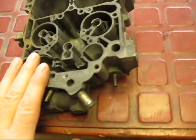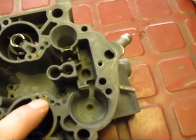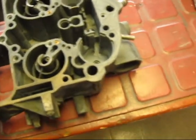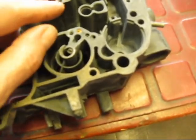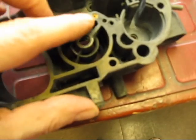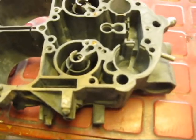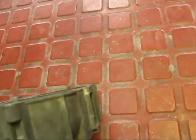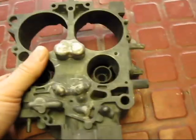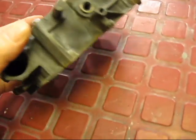Let's take a look at the body now. This came out of the acid wash — this is a fairly long pass. You can see those brass pieces there came out pretty damn clean. This is before I'm going to sandblast it. I need to make a modification to this carburetor body anyway — I need to deal with the idle circuit, which I'll show you later. But this is what the body looks like, and it's not bad considering it's clean. If you wanted to, you could spray this with a little clear, or even alodine it.